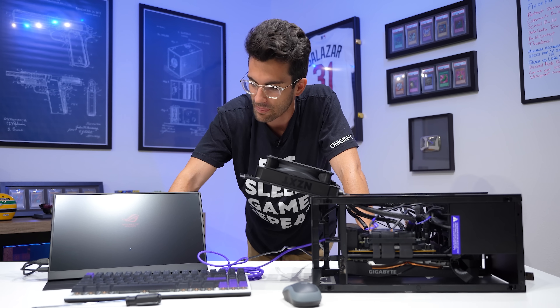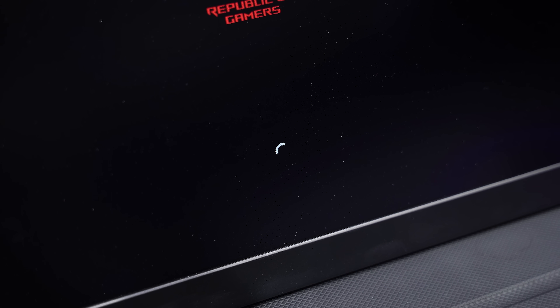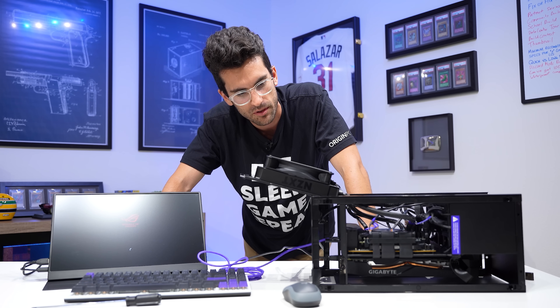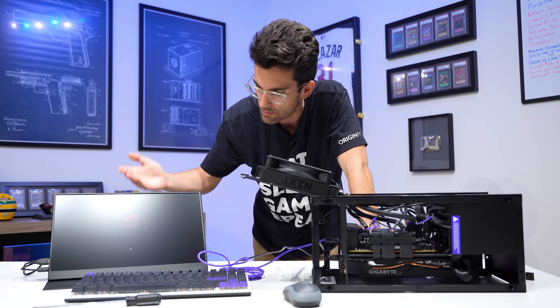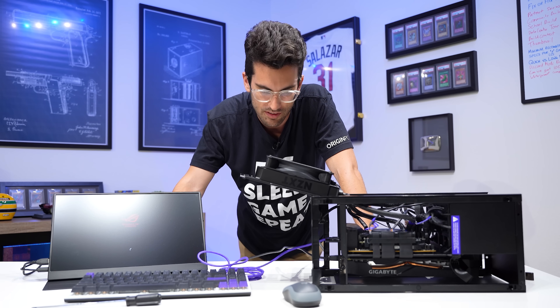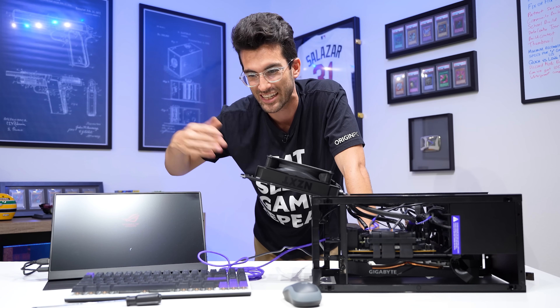There's another problem though. I can't get past this screen here. It like wants to load into my Windows bootable media and then it just doesn't. It stops, it freezes, and it stayed like this for a good five minutes without doing anything at all. He had a couple things enabled in the BIOS like secure boot, and I've been tinkering with those to try to get around whatever this holdup is. My last bet is CSM, which I don't like tinkering much with, but sometimes CSM does work wonders. So we're going to try toggling that and seeing if we can actually install Windows.